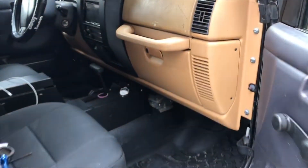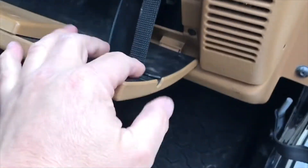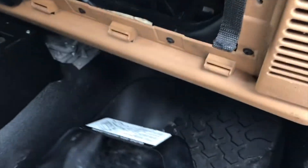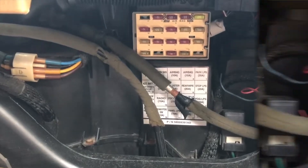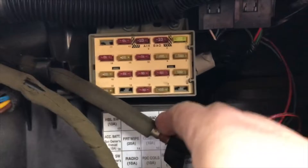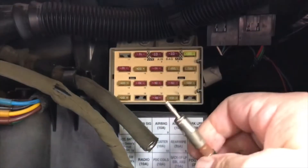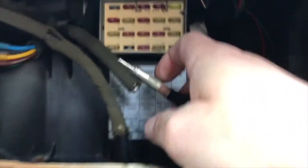Then you come into the Jeep, and the easiest way to access the cable is to open up the glove box. If you notice on the TJ, you just have that little strap. Pull the glove box off, and then you can see the wiring in here to the radio. The easiest way to do it is to move the wire and pull on the wire outside — you can see which wire is moving on the inside, which is this one here. On the TJ there's this connection, and here it is. I'm going to pull that all the way through from the opposite end.